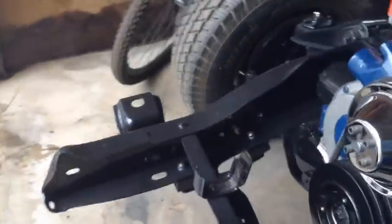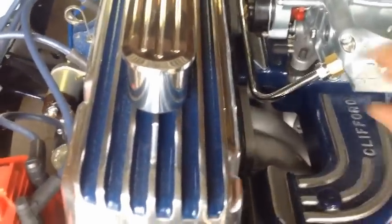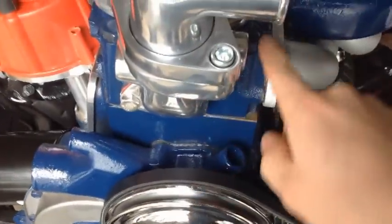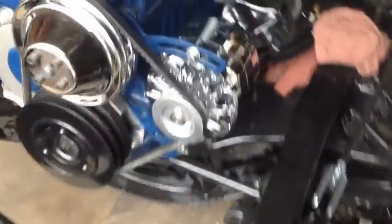I've got to modify my air cleaner and then start running some lines. I've got to run this PCV line which is going to run back there — you guys can barely see it — that'll be kind of hidden. Then my vacuum advance lines are right here. I've got to figure out which is ported and which is manifold, going to run it on ported. Not sure if I'm going to run that line behind the motor to the distributor or come down and just try and run it around this area here.